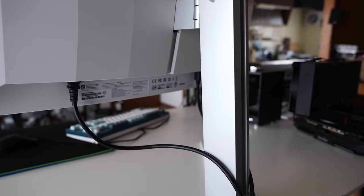If you're wondering whether you can wall mount this monitor instead of using the included stand, the answer is yes — Philips include the VESA mount kit. The stand itself is height and swivel adjustable. On the back you get four display inputs, with cables for all those types included, plus a power cable and a USB type-A to type-B cable for the USB hub, which powers four external USB 3.2 ports. You can also run that via USB-C with DisplayPort Alt Mode, and there's a headphone jack output as well.